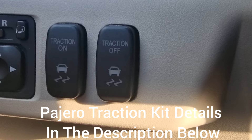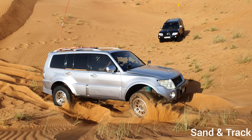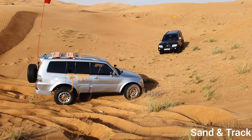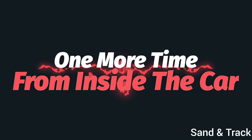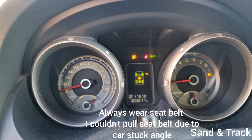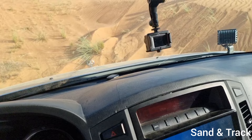This is an extra feature I've added onto my Pajero — details of this kit are in the description below. What it does is give us a mechanical lock on the rear wheels with the rear differential lock, while I use traction control to lock the spinning wheels on the front of the car, so that it acts like an e-locker on the front. Now that I've enabled the front traction control it also gives me front diff simulation — you can see now the car is moving. There you go, this is what the diff lock is useful for — to get out of these tricky situations.